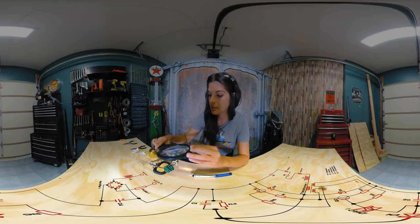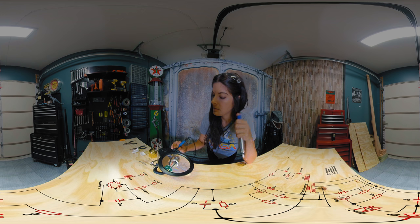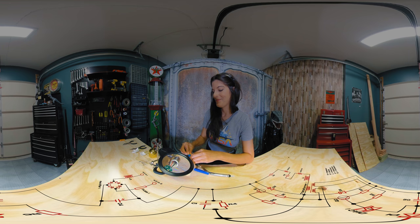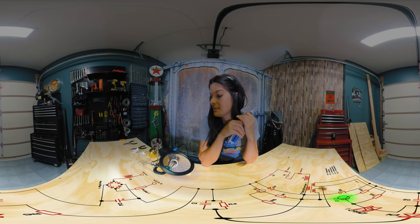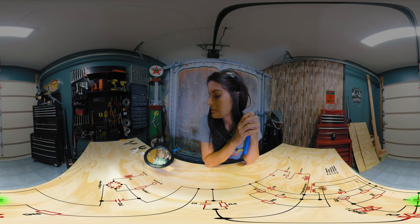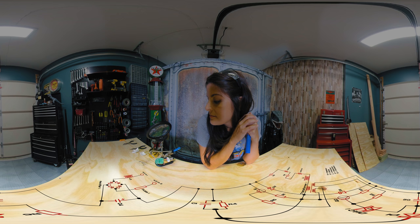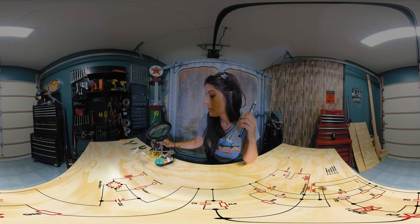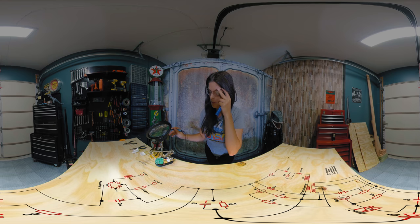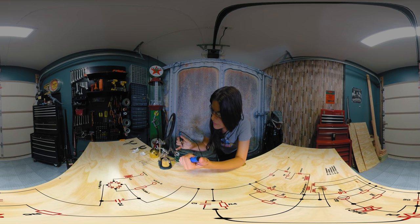The major players in the starting portion of the circuit are diode 1, capacitor 2, resistor 6, and the DIAC. A DIAC is a bi-directional semiconductor switch that can be turned on in both forward and reverse polarities above a certain voltage — the letters stand for diode AC switch. Through these components the signal reaches the base of transistor Q2 and causes it to open, which discharges the C2 capacitor so the DIAC can no longer reopen. Once at transformer TR1, the voltage gets stepped up to over 600 volts in preparation to light the bulb for the first time. The transformer consists of a ferrite core with three windings. C3 discharges and the light bulb turns on. With the starting portion done, diode 1 blocks that section out, and during normal operation the bulb needs less voltage, so C6 now takes over.